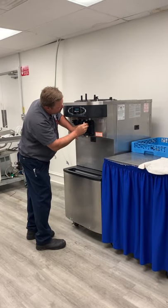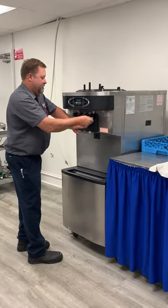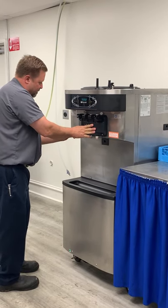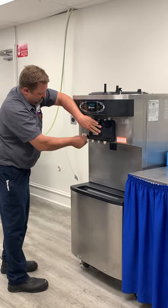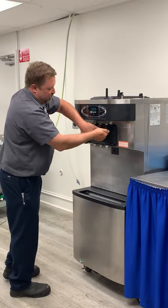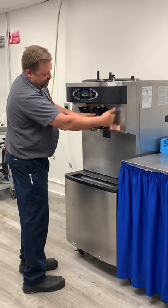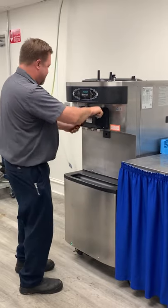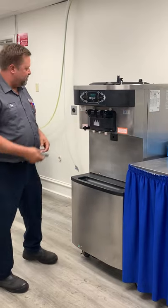Tall screw on the top, then a short one on the bottom on the opposite diagonal corner. Snug these down by hand — you never want to use a tool to crank these down. If you do, you can bust off the stud flush with the front edge of the machine, and that takes your machine down because you can't put the door on. A tech will have to come out and it'll take several hours to get that out, so it's not a good deal.